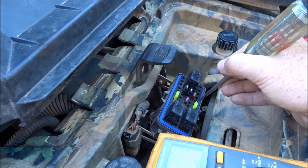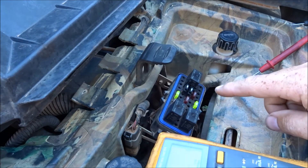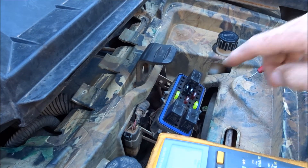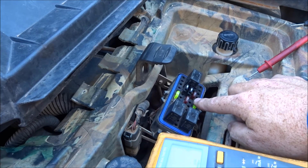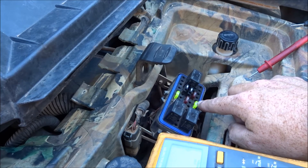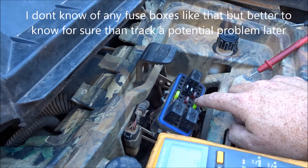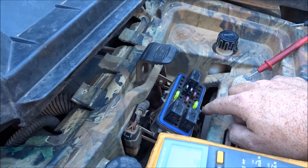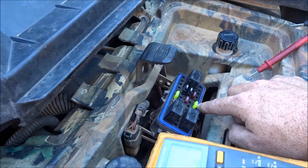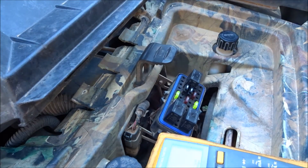We will tap into this circuit here. Something else that would be important to find out is how much voltage is coming here. If this is a step-down from 12 volts to, say, four and a half volts or something like that — we know we have 20 amps, and most likely it's going to be 12 volts, but we need to double-check. If we run our voltmeter to this and the circuit is only supposed to have seven and a half volts or whatever, then it's going to give us a faulty reading. So we'll go ahead and test that now.